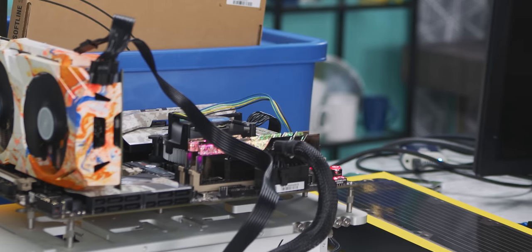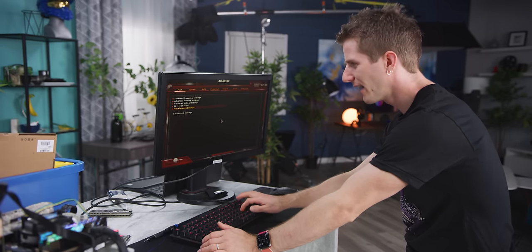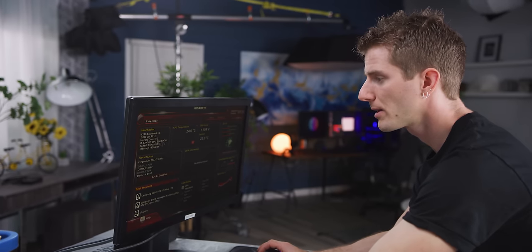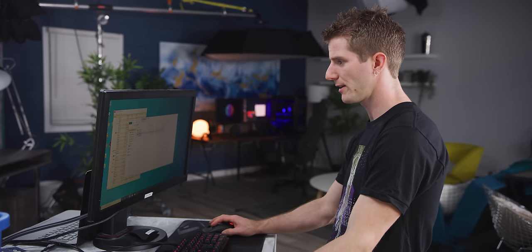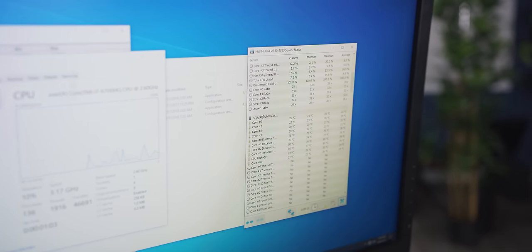We're ready for the magic moment. Our RGB RAM is lit up. We have all the functionality we need — let's see if we can get into the BIOS. F2, Delete... This doesn't appear to list a CPU model anywhere. Yes, so we are unlocked. This is a 6700HQ. Why would that be unlocked? That shouldn't be unlocked. Let's get into Windows first, get some hardware info fired up. Everything seems to be working relatively normally — there it is, 6700HQ running just like you'd expect.